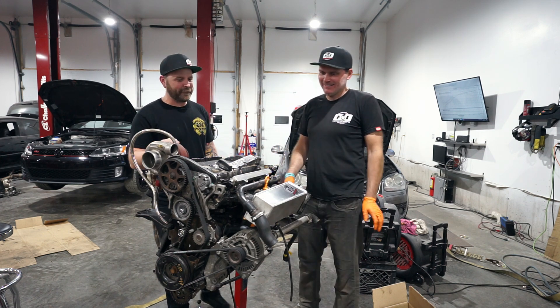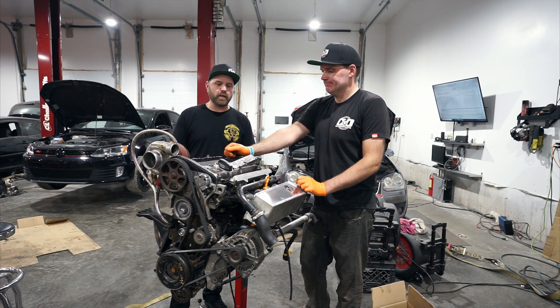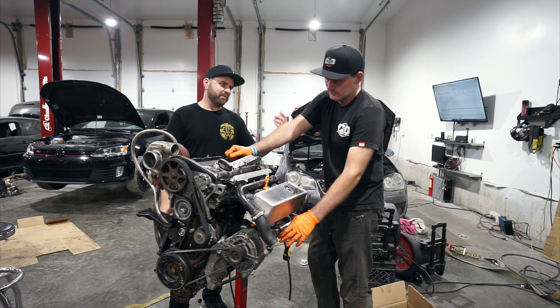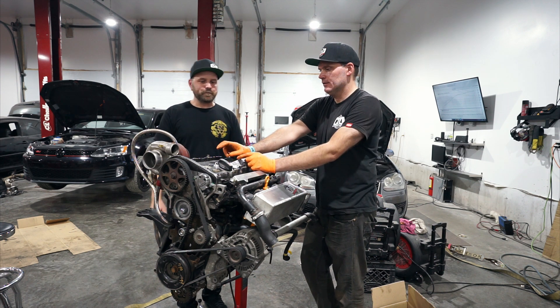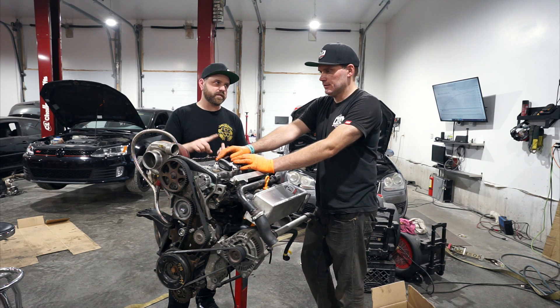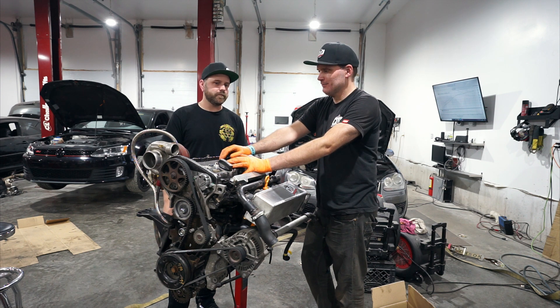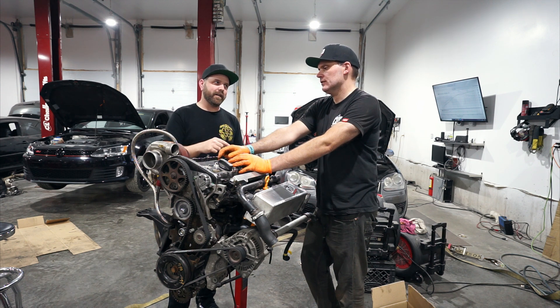The last thing you saw was Cale and I fighting the engine out of the car and getting all the accessories off. Since then I filmed nothing because I was in a rush to try to get this back together, and then a couple things snowballed. All the parts were good and everything went fairly smooth — it's just that plans change and upgrade time, for the better this time. Upgraded exhaust valves, upgraded springs — which is going to be super nice up at the track. Super Tech valves, Super Tech springs and retainers. Bigger injectors — might still want to go bigger yet, we'll see.